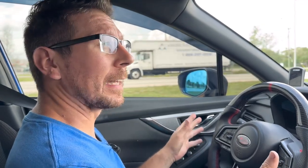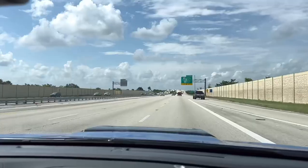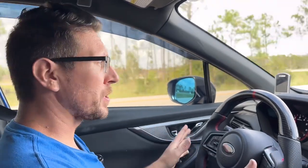With that being said, we're ready to take this thing out and do three separate data logs in the conditions listed in that email. For our first set of logs, we're going to try to keep the car between 45 and 55 miles per hour for several minutes. Depending on where you live and your traffic patterns, this might be the hardest one to get — but please be patient, because the numbers that Clark gets on these logs is what determines how good your tune is going to drive. It looks like we have our cruising log done, so now we're going to move on to our partial wide open throttle log.